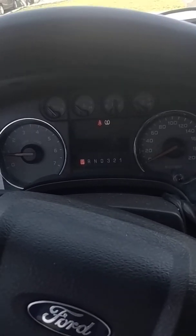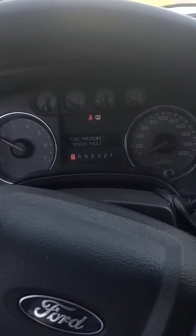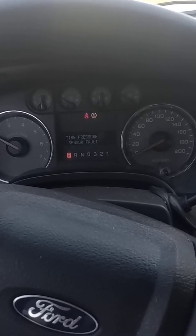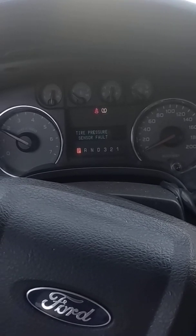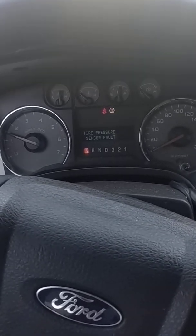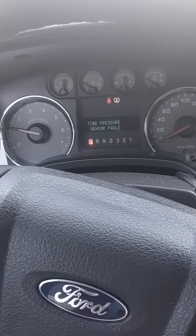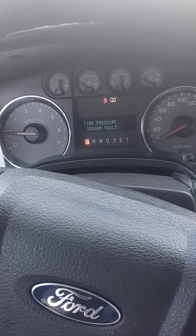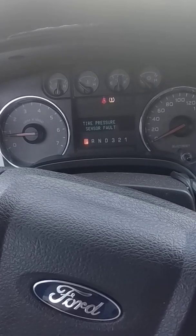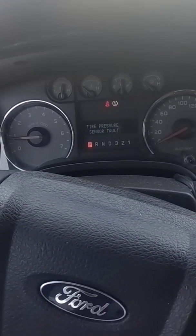There we go. Here we go. Had a hard start. Idles are a little high. That seemed to have helped a little bit. You heard it skipping. Now the idles are dropping. I'll give it a shot of gas with the foot.